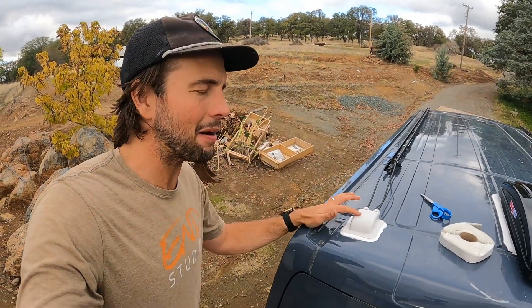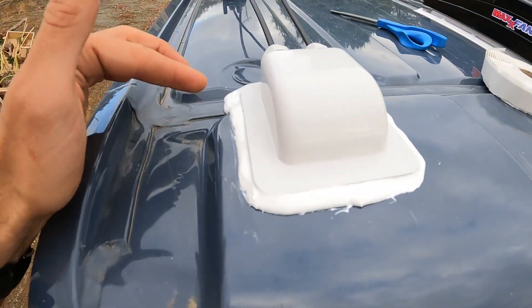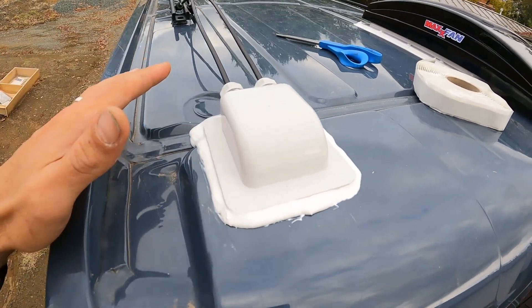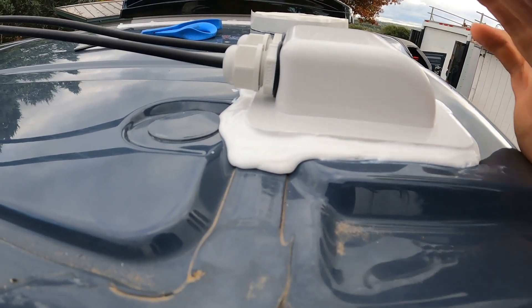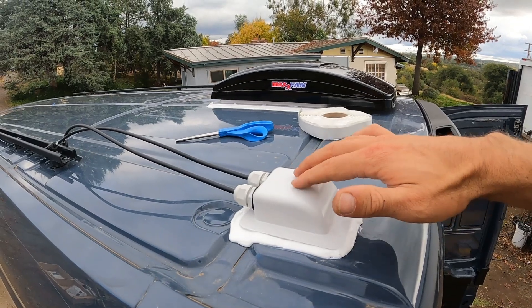The solar gland's installed and I'm happy with it. I laid on the lap sealant nice and thick, which you're going to want to do. It's a self-leveling lap sealant, so I'll come back and clean it up a bit when it dries. I had to really lay it in heavy here as the van dips down, but it's good — it's watertight and I'm happy with it. This is an easy installation. It's a quick, easy module — one of the first parts of wiring your van — and now we're going to get into some more wiring modules. Hope you had success and your van's getting closer and closer every step. Next module, we're going to dive into some more wiring.